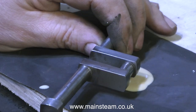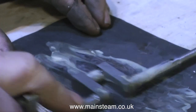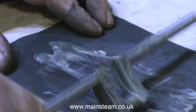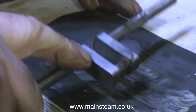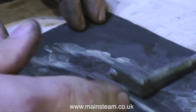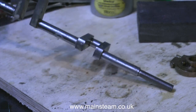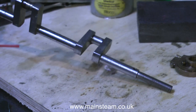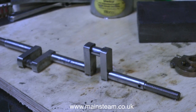If you're doing a job like this, it is really tedious, and you must not apply too much pressure, otherwise you're likely to make a mistake and wear something out very quickly. It's just back and forth on different grades of wet-or-dry sandpaper. And eventually the crankshaft starts to look something. It's not 100% there yet — I need to do a little bit more cleaning, but it's getting there.